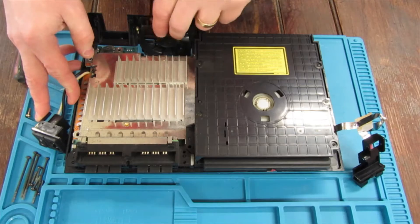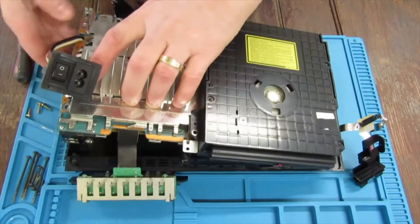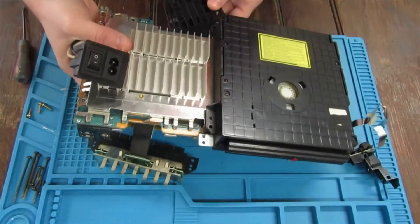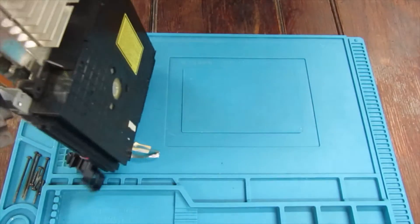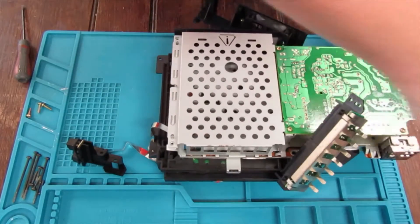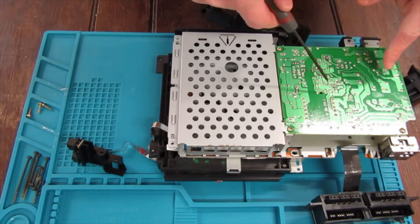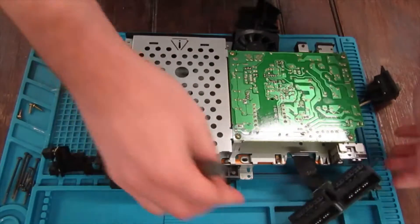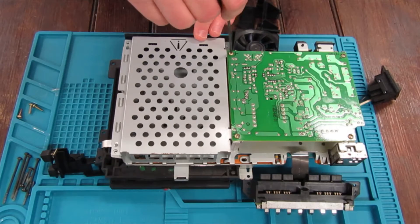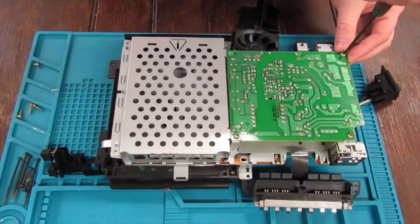This is held in by a little cable over here on the fan, so you don't want to stress that too much. The console should now pop out of the bottom. Flip it over — this is the power supply board. If you just had the console on, be careful here: there's a big capacitor on the other side that could still be holding charge even with the console turned off. These are shorter screws than the previous ones, so maybe keep them separate.